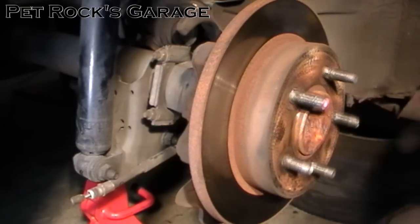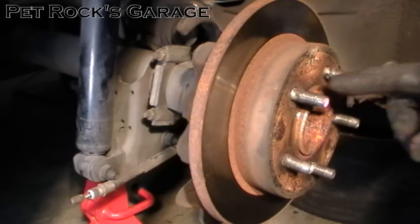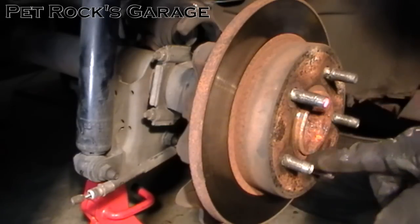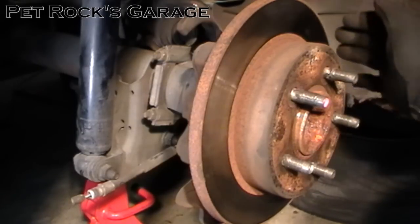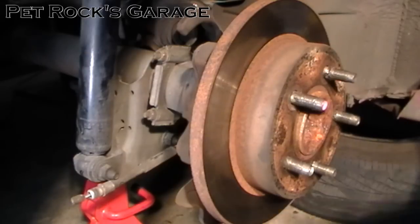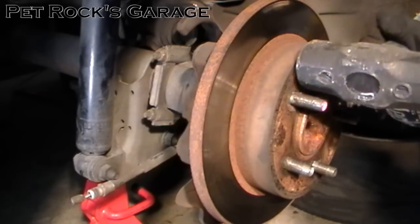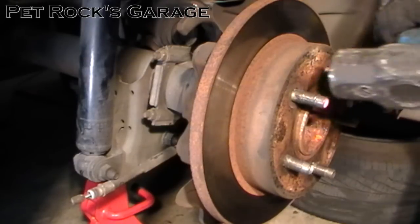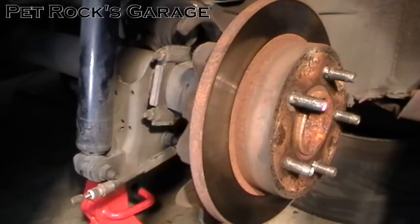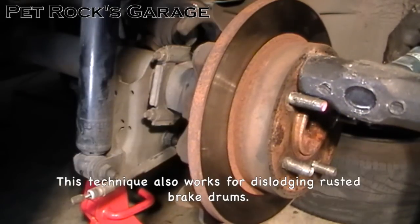Once the car is in the field the tire with the lug nuts holds the rotor in place. If you live in the rust belt where there's lots of salt on the roads, it may be difficult to remove the rotor — it may have rusted to the axle plate or around the hub ring. Try hitting the rotor with your palm at 12, 6, 3, and 9 o'clock. If it still won't give way, take a large hammer, place it between the rotor and a solid surface, then hit the back of that hammer with another hammer. Don't whack directly on the lugs or you'll damage the threads.